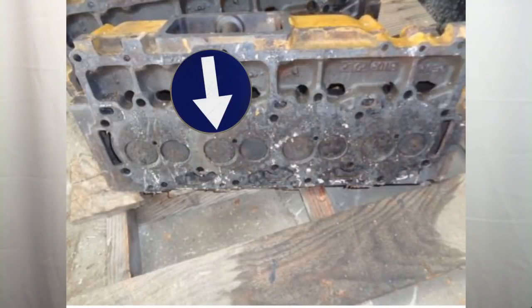This engine uses two cast iron heads. It's a pushrod engine, which means the camshaft is in the block. It's also a flat tappet engine — after this, Cat stopped using flat tappet and went to a solid roller design with less friction and longer camshaft and lifter life. It uses a single intake and single exhaust valve. The compression ratios could vary from 15.5:1 up to 18.2:1, varying depending on whether you had a turbocharged or naturally aspirated version. It looks very similar to a gasoline V8 engine internally. There aren't the bolt-on-style piston cooling jets that most modern diesels have, and it has very small rod bearings and main bearings in comparison.